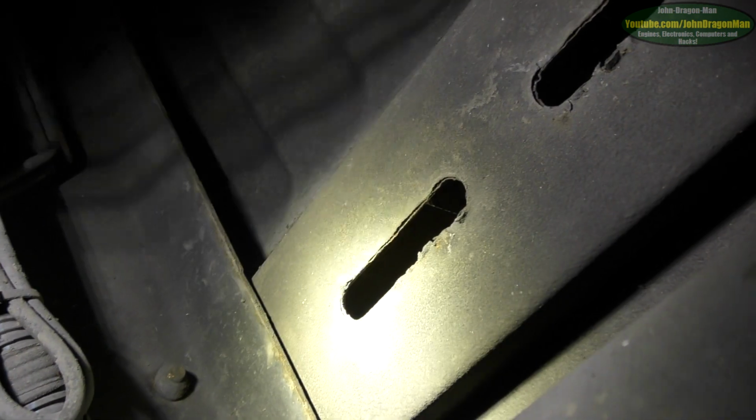It could be worse. You can see where it starts to go. If you look inside these cavities here, look. There, you see inside that? See that rust? Nothing much I can really do about that. Bit of a pain in the ass. But through the holes I can try and get in there as best as I can and scratch all the old rust off and paint it through the gaps. Not ideal. And then cavity wax the whole thing, which is the plan.